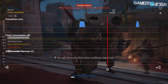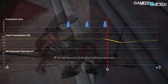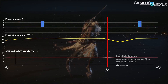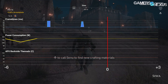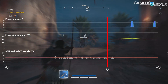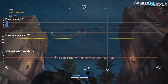Thermals, power consumption, and frame rate all plummet whenever we die due to a black loading screen — expected behavior. The Xbox One X maintains roughly a steady-state 62 degrees Celsius APU backside temperature under gaming workloads with our improved thermal paste. Front-side silicon temperature is probably closer to 70–75 degrees Celsius. T-case max is about 85 degrees C before a thermal shutdown event. We were never able to get the Xbox to thermally shut down unintentionally, and there's no thermal throttling or temperature spikes aligning with frame rate drops — it's just combat creating more work for the APU.